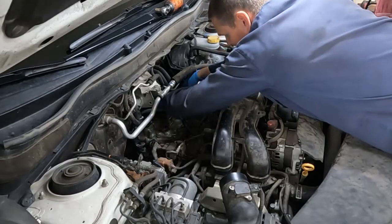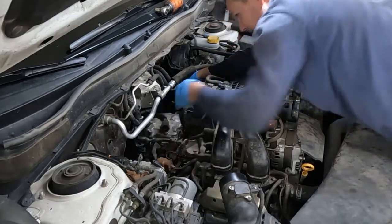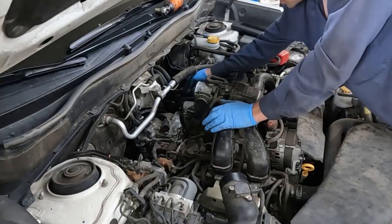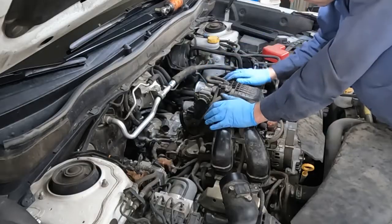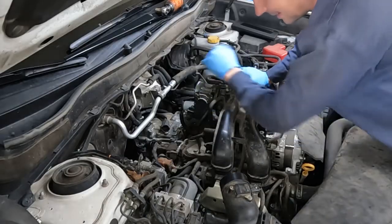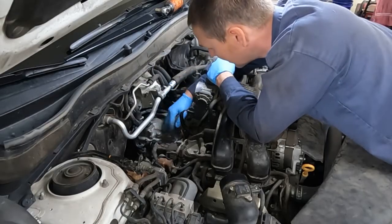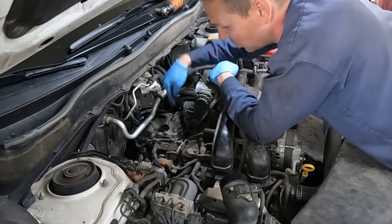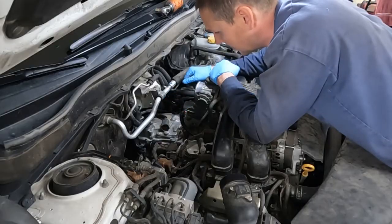Something I didn't mention — it's just always a good idea when doing large repairs to disconnect the battery so that we don't accidentally short anything out. We're working really close to the starter motor, so there is a live positive feed going to that starter solenoid. Disconnecting the battery will help so we don't accidentally short anything. Everything looks clean. I'm going to spray one more time, and then it's just a matter of 10 millimeter bolts around the whole perimeter and this top is ready to come out and separate.